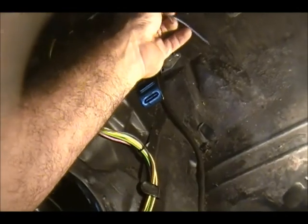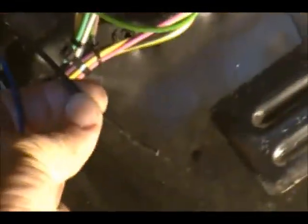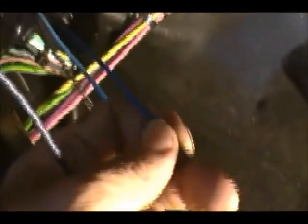There should be 3. There's that short one way back there. Alright, you see it? It's cut. That one is the pump. That's the pump. The squirter gets twinned together with this one, black. And then this dark blue goes on the top of the high of the switch. This black goes on the low. And then this light blue is the power. So I gotta make a pigtail, so it's gonna be a little while. I gotta get some stuff ready. And I don't think I have any more butt connectors, but we will see. And one step closer. Okay.